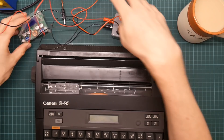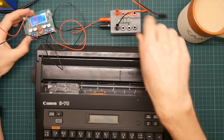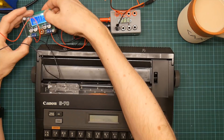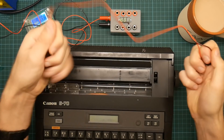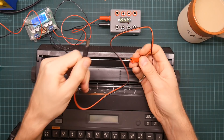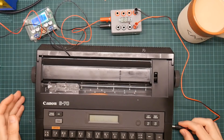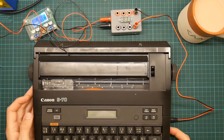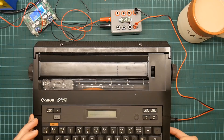So let me get out my little bench power supply. Power it on and crank it up to six volts. I checked earlier that this is in fact the right size and this is wired up for center positive, so I actually want to plug this in backwards, which is kind of unnerving. We plug in, we turn on. It did something. It's drawing about 10 milliamps. Interesting, nothing appearing on the screen.